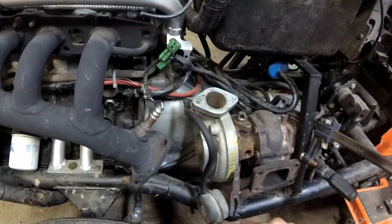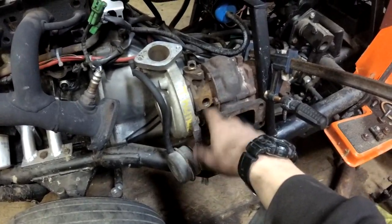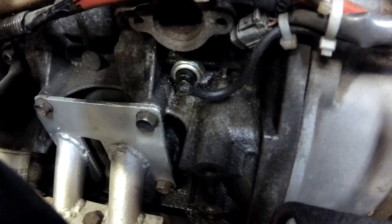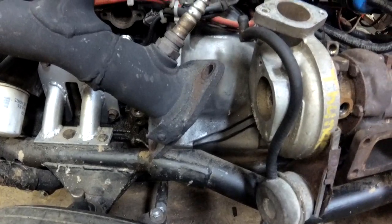We're not going to run an intercooler — I don't think we need that and I don't have room for it anyway. I have to get coolant over here, which the old heater core hoses on the other side will work good for. The oil feed I can get out of right there. The drain I'm going to have to go into the pan, out the bottom.